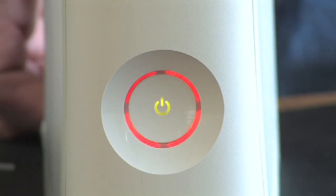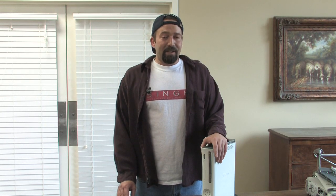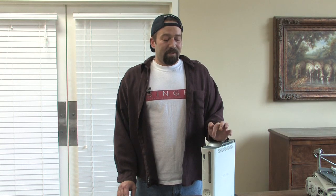Basically it's an indicator from the Microsoft Xbox saying that it overheated. If you look on the front of your Xbox, you'll have four lights on the front of it, which are normally green when it first starts up. If you first start it and you get one red light, the next time you start it, it's going to turn into a red ring of death. Basically that's the over temperature sensor on the motherboard indicating that the video graphics processor has overheated.